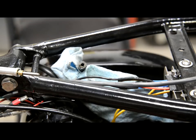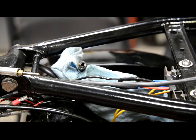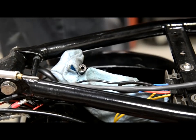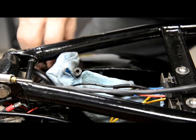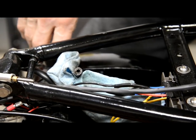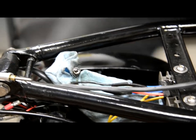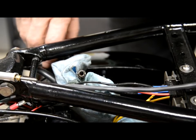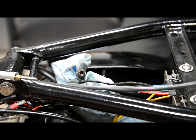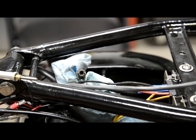So what you're looking at is the bit of rubber tubing that the rocker feed goes onto. So if you watch that carefully, come on now, tell you what, let me put my finger over this hole here so it comes, there you go. Right, take my finger off and it'll still come through. So if it's coming out of there, it means it's gone all the way down the pump, through the pump, through the big end, into the sump, up the pickup, back into the pump, and all the way back here. God, that was annoying me.